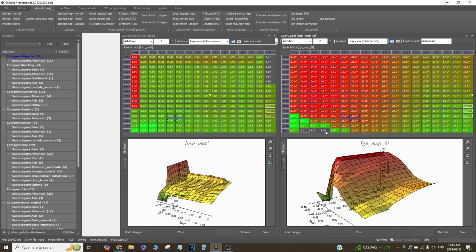These bottom cells are what's used for idles, so up around 1700 RPM, 6 degrees, and below that 9 degrees. So it kind of bounces in between this point, or finds an equilibrium between this point and idles smoothly. And also in the fuel map, I have kind of a fuel cut when it gets too high in RPM. So again, pulling fuel out makes the idle drop, adding fuel makes the idle come up. So it'll just find an equilibrium point between here, and that's around 1200 RPM.